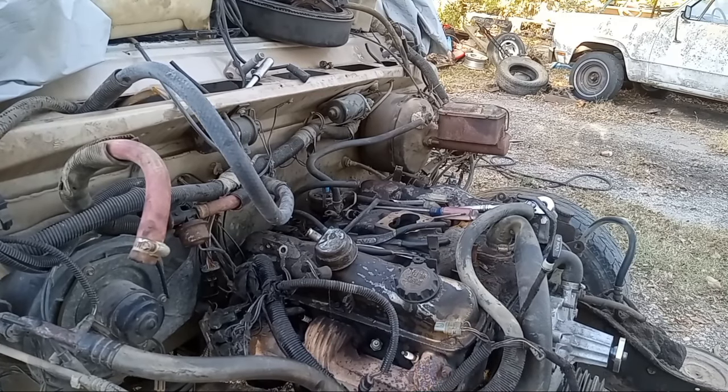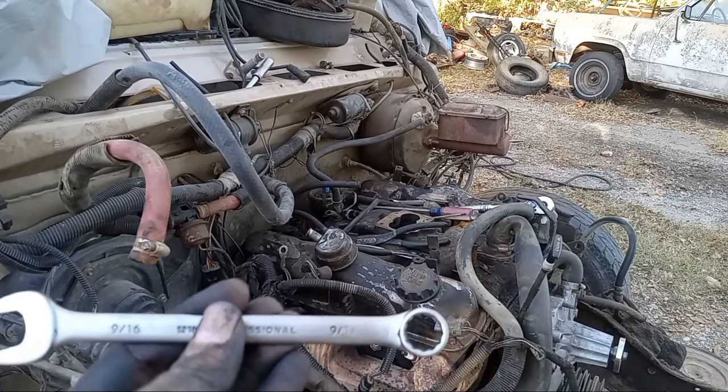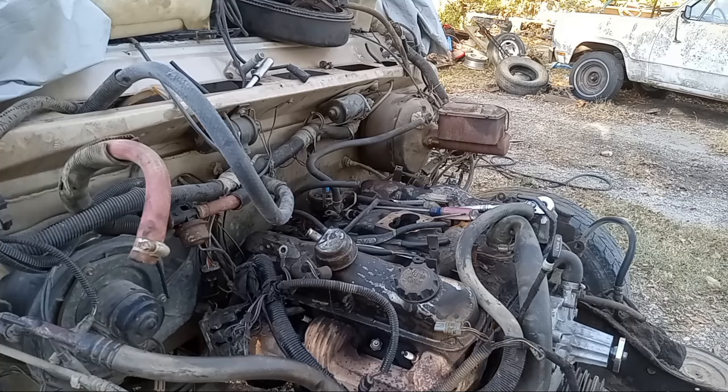That was a struggle and a half. The power steering pump was a struggle getting out, had to wrench a bolt. And then that last bolt was a bell housing bolt, because this weird U-shaped fuel pump line hold bracket was on there. The only way to get that off was with a box end wrench, backwards, and there was no room to get your fingers in there. Really great design. But we got her out, so no issues there.